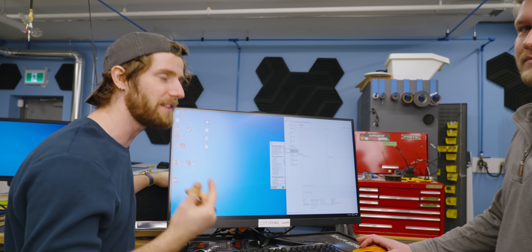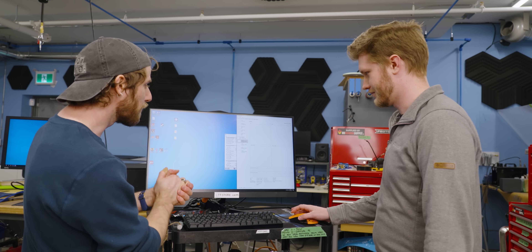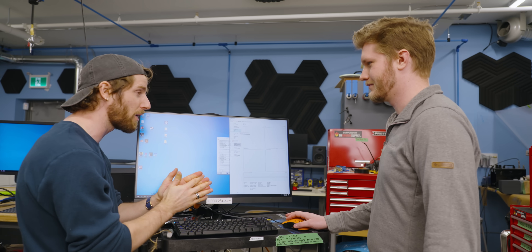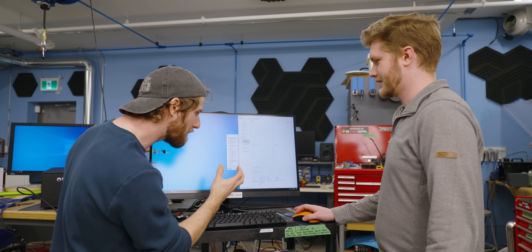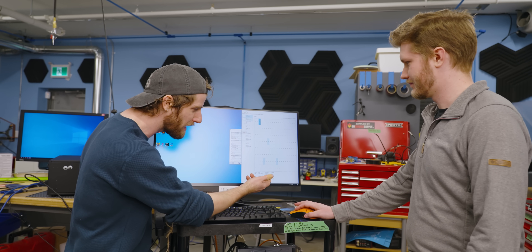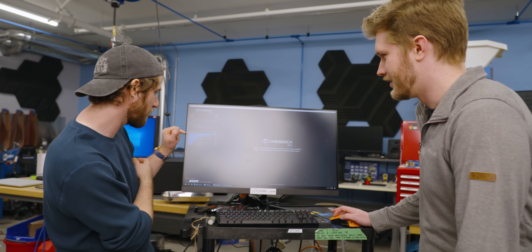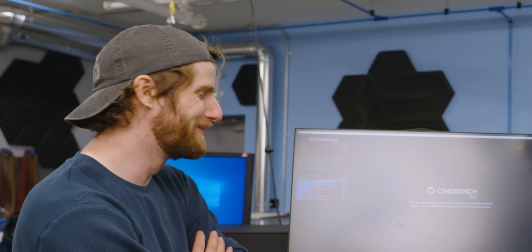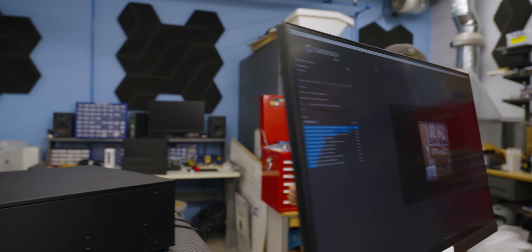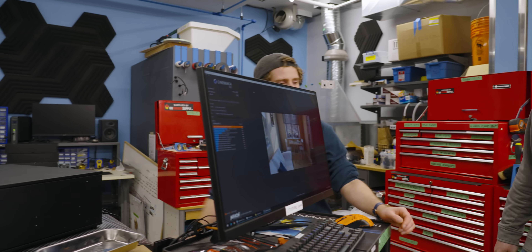Do I get to know what GPUs they are now? They have the A6000s in there, which means those must be 3090 Ti's - actually they're 3090s. They sent them just so we could show them getting swapped and show how easy it is. We've got 200 gigabytes of video memory - 48 gigs each. The CPU screen shows 76 cores, 152 threads. These are each 38-core Xeon 8368Qs - base 2.6GHz, turbo 3.7GHz, 270-watt TDP, maximum memory size of six terabytes each. How does it compare to a 32-core 2990 WX? I think favorably.